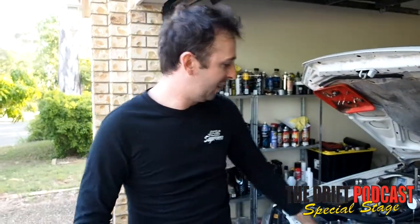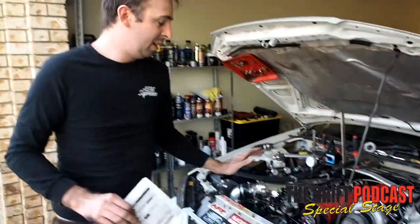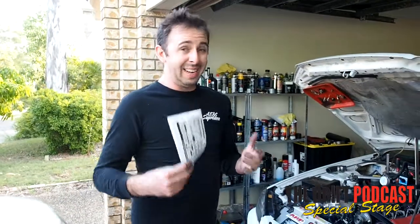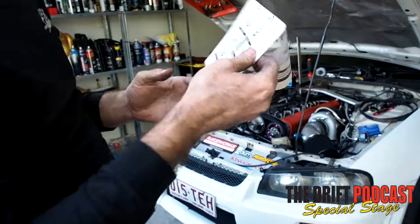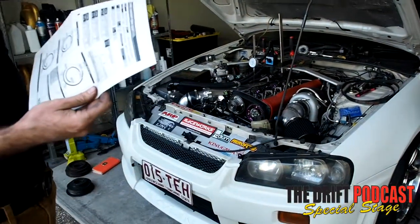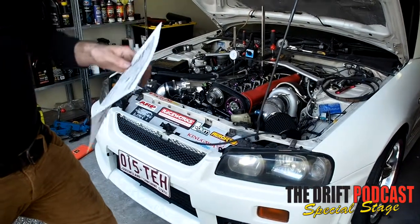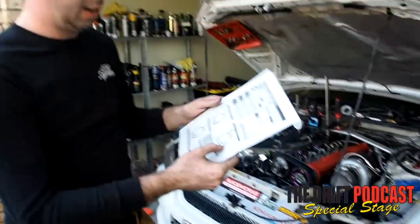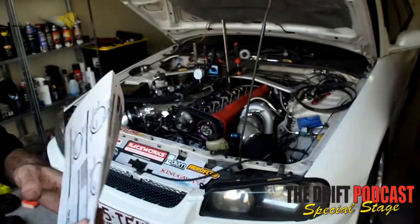That is the basics of doing cam adjustment. It's a lot easier to do with an actual wheel because you can have timing marks on the degree wheel to show you where you should be at. There isn't much information out there on how to do this properly. Another point is that you also have on here your intake lobe center. What you can do is re-adjust the height of your dial indicator so that it will indicate where maximum valve lift is, and you want that maximum valve lift — your lobe center — to be at 120 degrees. That's how you can check your work once you're done.